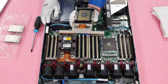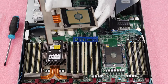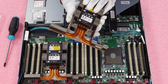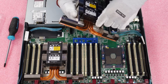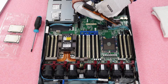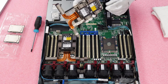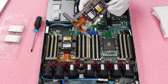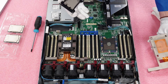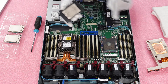Lift it straight up and flip it over. You'll notice the CPU is actually hooked to the heat sink. Dell 14th gen servers have a very similar setup with a clip that is separate from the heat sink. There are points you push out to release it — push this in and it pops out. Do the same on the other side, push in and come down. Now the CPU is completely removed from the heat sink. You can see the thermal paste isn't too bad, but we'll need to clean it off.